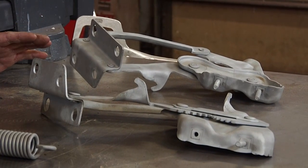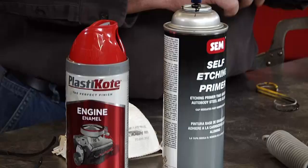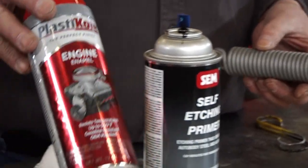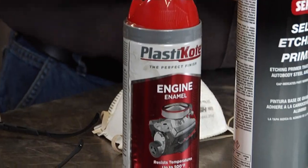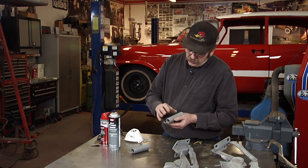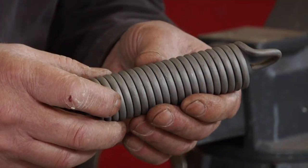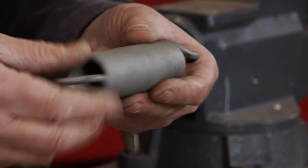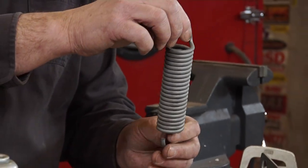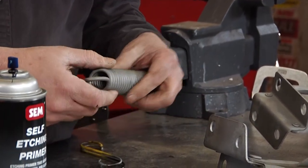Now that we've got everything blasted, our next step will be to paint these hood hinges. We'll be using a self-etch primer, which contains an acid that helps bond the primer to the metal surface. After that I like to use an engine enamel — they dry fast. You don't want to build up a lot of thickness with paint on these, otherwise it tends to chip. You don't need to spread the springs apart before painting because as the springs collapse they touch themselves and wear the paint off anyway. Plus when the hood is open the spring is almost fully contracted, so you'd never see in between there anyway.